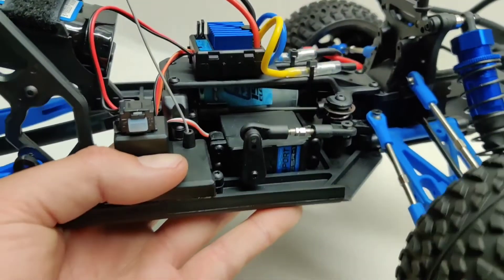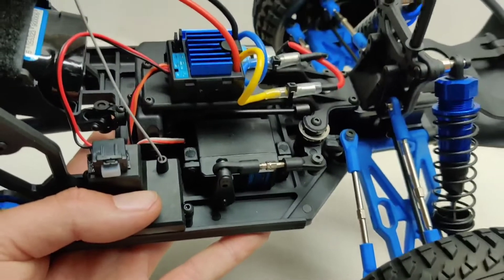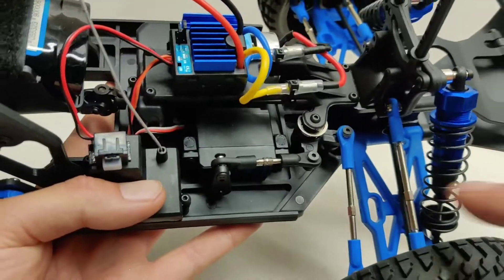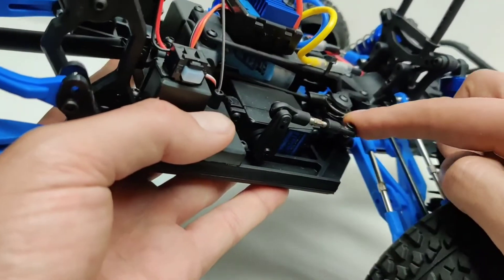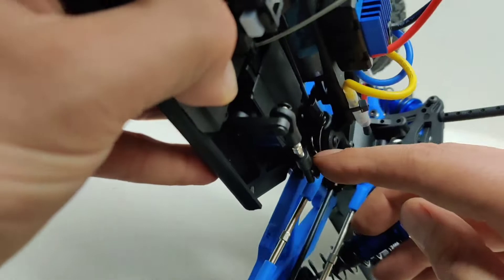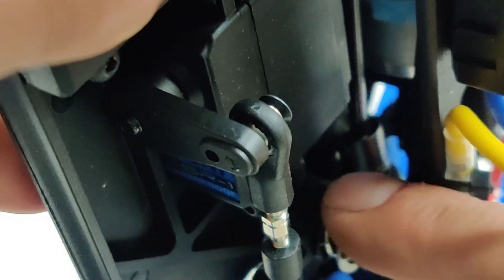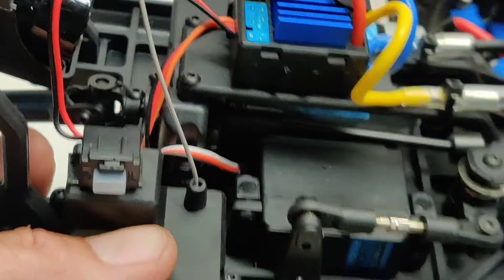Hopefully the servo saver is not too soft. If it's too soft and you're going through rough terrain or trying to manipulate the car through a turn for oversteer or understeer, it becomes an annoyance. This is great for bashing and great for newbies, but as you get better at driving you might find it's a problem. Sometimes you can fix these by using a soldering iron set to about 500 degrees. There's a little seam joint on the servo saver — you can take the soldering iron and go back and forth to basically weld it together, and that should improve things.